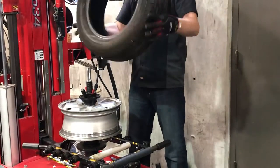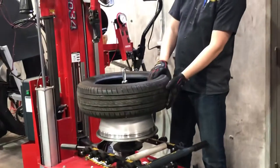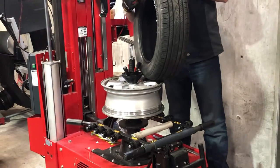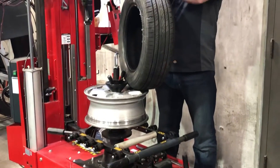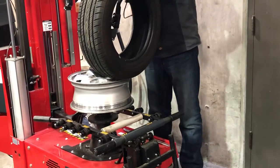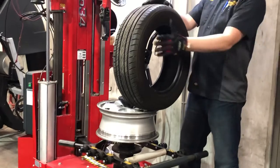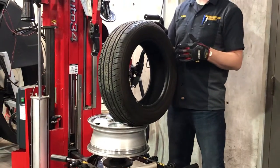Will it still go down the road if I put it upside down? Sure, but it's got a design in the tread for controlling water and it's expecting the wheel to be spinning in a certain direction. Some tires are directional — there'll be a cut kind of like an arrow, and it'll say 'direction' on the sidewall. We just need to make sure that whatever two wheels are going on the left side of the car are mounted in the correct direction. If it doesn't say inside, outside, or directional, then look for consistency — match any raised lettering for a uniform appearance.